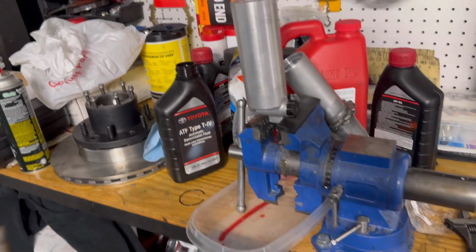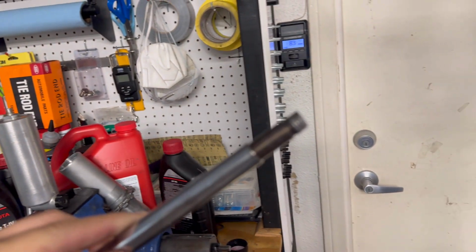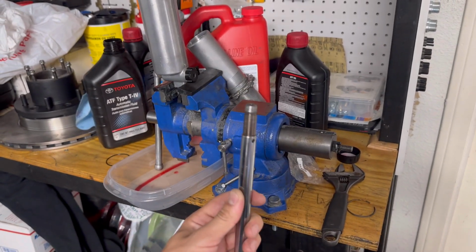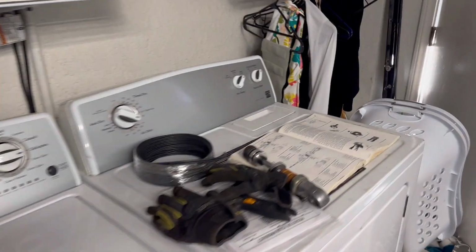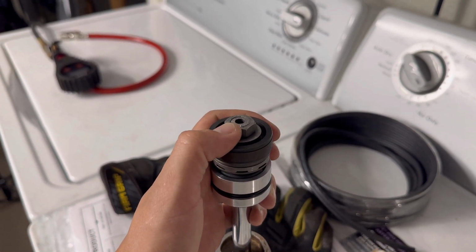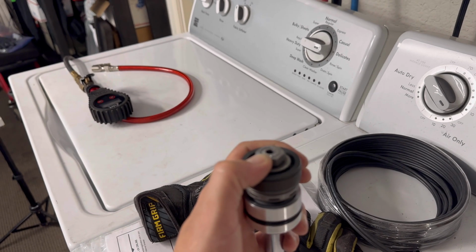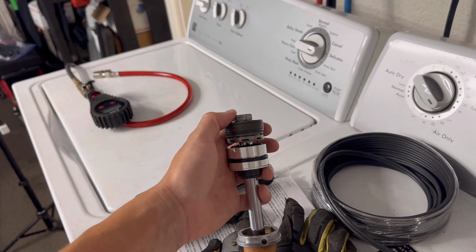But I just wanted to let you know this shock shaft is completely annihilated. It was my fault. I did not grind off enough of the shot peen. So let me show you. I had to order another used shock, and right here where you can see the top of this thing, I had to grind it. So there's about, let's call it a 1/4 inch of shaft that sticks up past this nut, and I thought I ground enough, but I didn't.